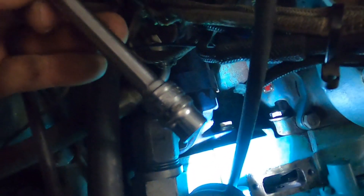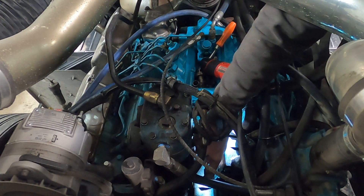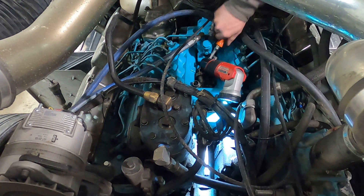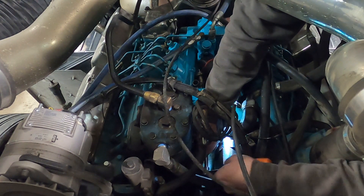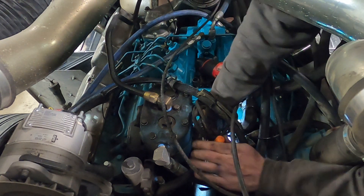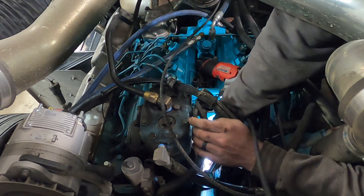I just have the bar on the engine, turning it over with the pry bar up in the fan. On the back of that hub - see that bump out? That means there's a bolt there. What you need to get that bolt is a 3/8ths 12-point socket in that plug hole. We'll just go ahead and rock the engine back and forth a little bit with the bar. The socket will drop on, but it's only in so many spots it'll do that. You want to make sure that the one with the hole on it to set the timing - you want to do that guy last. Because that means you're going to be up on number one firing, and that's where you're going to want to adjust for port closure.